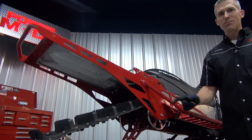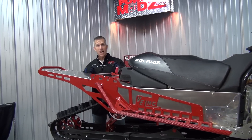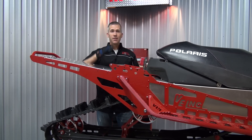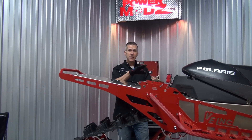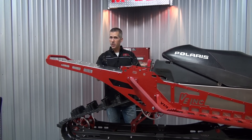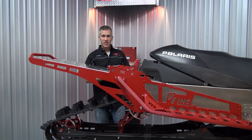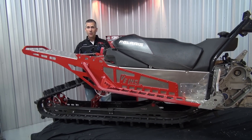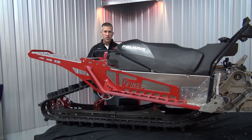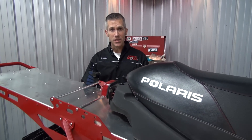What an awesome looking suspension — this thing is going to be awesome to try out. I've heard rave reviews on it. It comes in at 34 pounds, which is the lightest suspension I've ever ridden. This is a fully coupled suspension with a very low angle of approach. The way it's designed, when it articulates, it always maintains that low angle of approach — that keeps you from trenching. You don't want to trench when you're playing in the powder; you want to stay up on top. Every component on this uses the lightest weight materials: carbon fiber, titanium, 7075 aluminum, and chromoly. The carbon fiber components are very resistant to snow buildup, which is great — you want it to clear right out when you're playing in the powder.